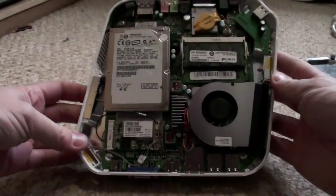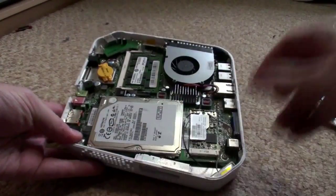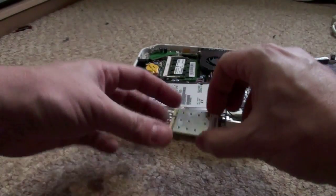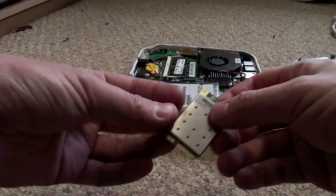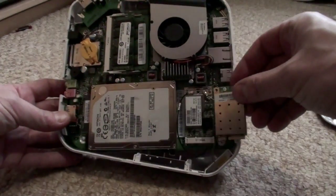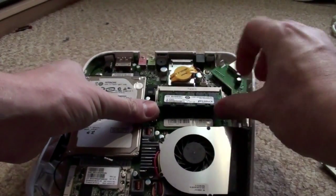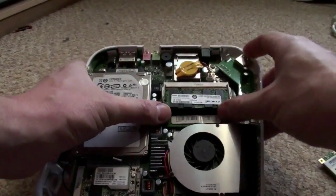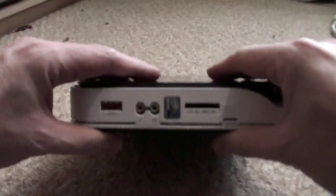Inside it's just like a standard laptop - a 2.5-inch hard drive, standard laptop-type memory, and down the bottom is where the Wi-Fi card lives. The Wi-Fi cards are pretty easy to swap - they just plug straight in. The only tricky bit is the two little copper lugs on top that the aerials have to plug into; be careful not to damage the aerial. There's a black one and a grey one. Getting the memory out is simple too - that's the two gig stick I put in, which brings it up to three gigs. Putting the case back together you just line it up and click around the edges.